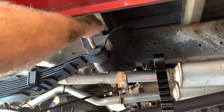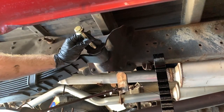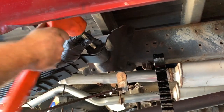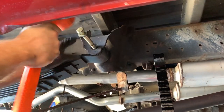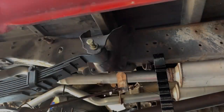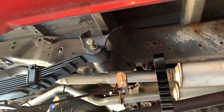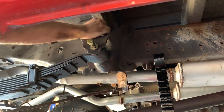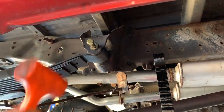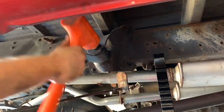Once you have it lined up close enough that you can go ahead and start the bolt safely without stripping any of the threads, you can use the new hardware as a mounting point holder to ensure you don't lose one side while you continue to manipulate the back side to get it all the way through. A good way to do this is to change the angle of the spring by hand or even use the floor jack to change the angle slightly. You'll find that this will align the holes at the last minute a lot easier, and a quick tap will finish you off so that you can press the bolt all the way through.